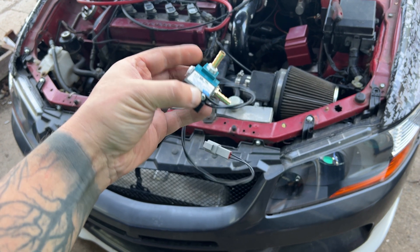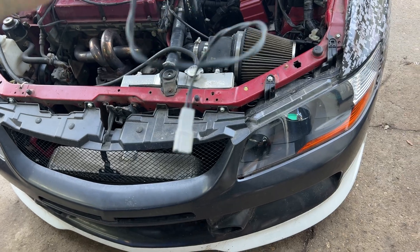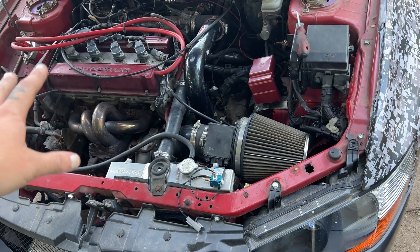I just checked and unfortunately it's a wastegate solenoid failure — we're only around 18 pounds of boost now. My buddy Derek hooked me up with a 3-port MAC valve, so let's put this in. I've got to change over to a DTM connector real quick and then hopefully it's all working and I can keep tuning. It shouldn't take too long to put in.